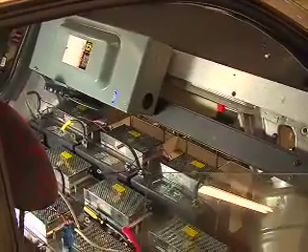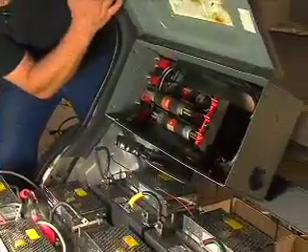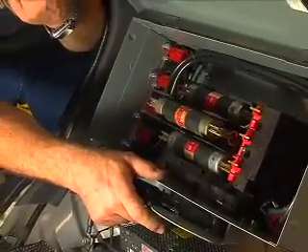We never got video of installing the AC controller — there's a big box in the back of the car. What we've got here is an industrial disconnect, the kind you see in factories hooked up to big motors — it's the grey box back here. If you look inside it, there are three switches and three fuses. My battery pack will be divided into four sections. When the switch is off, each section will be isolated and no section will be more than about 75 volts. When I flip it on, it puts them all together.